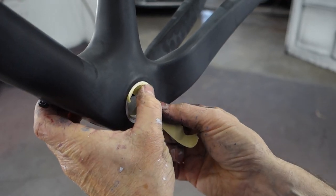If you have slight scuffs or gouges in your frame and want to fill those, you'll need to do some slight bodywork with a little bit of filler or Bondo. There are tons of videos on how to do that properly. Essentially you fill those voids, then sand down to level the surface and get everything to a uniform finish. You can use more aggressive sandpaper to sand the Bondo down, but eventually you want a smoother, more consistent scuff using gray Scotch-Brite or a higher grit like 800 or 1000 grit sandpaper.